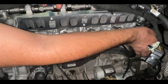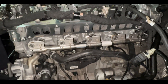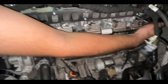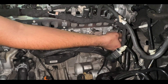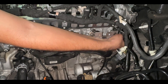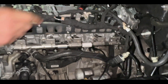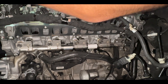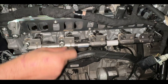Make sure you put the clamp on before you put your fuel injectors in. Slide the fuel injectors in nice and calm and steady, then go ahead and seat them down. These are torqued to 89 inch-pounds, wait five seconds, and then torque them down to 124 inch-pounds. We'll put the conversion to foot-pounds in the description. Lock the rear connection into the fuel rail — that's where the fuel will pour out if loose. Torque it tight enough that fuel won't pour out since it is high pressure.